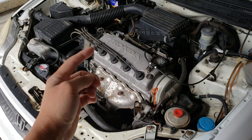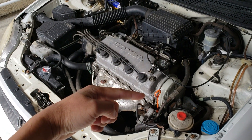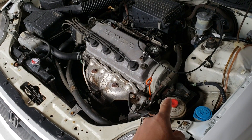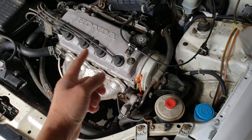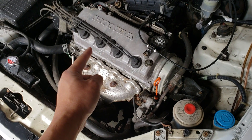The fuel pump should not prime when I crank over the engine, because I don't want fuel spewing into the cylinders while I'm cranking. So how do you know which is cylinder 1, 2, 3, or 4? Typically it is coming from where your belt and accessories are. So counting back, cylinder 1 is right here — 1, 2, 3, and 4.